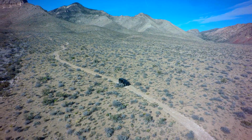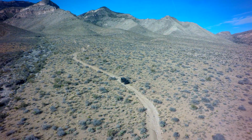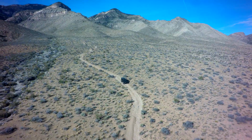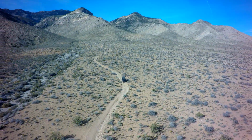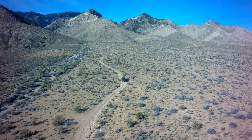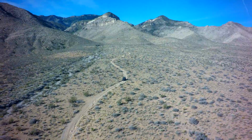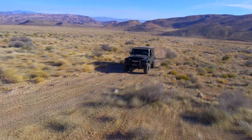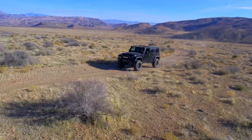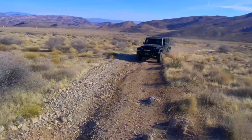So getting back to our methodology, we wanted to keep the operating system pure, the GM network pure, which we did. And the advantage of running our early digital analog interface is that we did keep it completely pure, no integration into the CAN network. The beauty of this is the GM side could remain completely GM, and the Chrysler side could remain completely Chrysler. A Chrysler dealership could service the Chrysler side, a GM dealership could service the GM side.